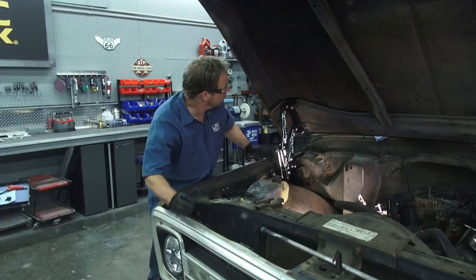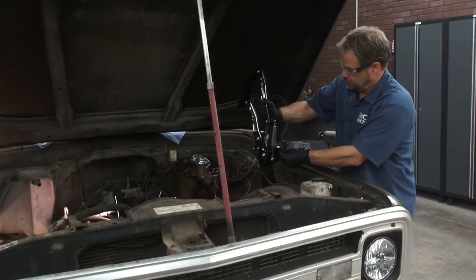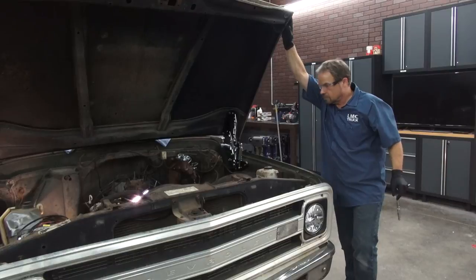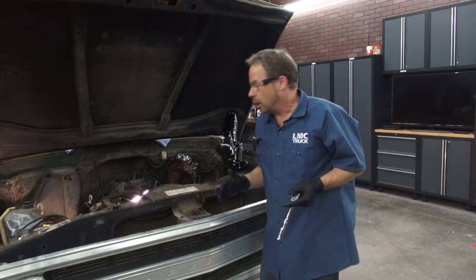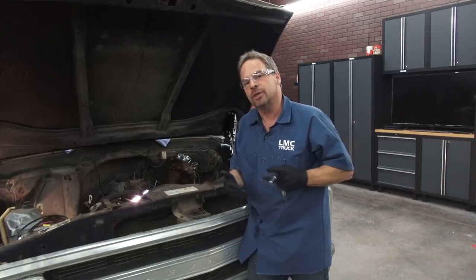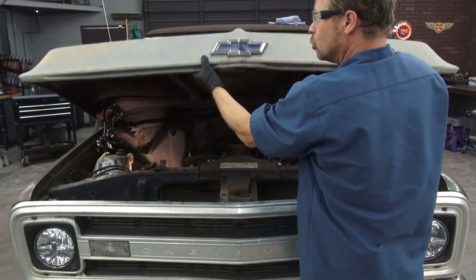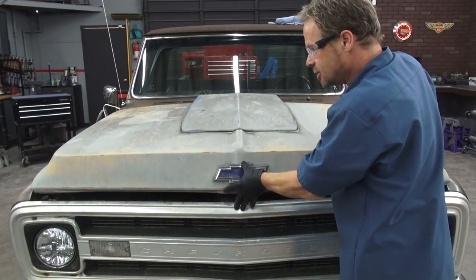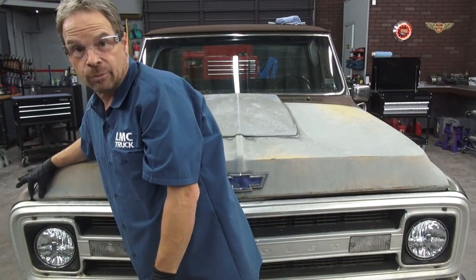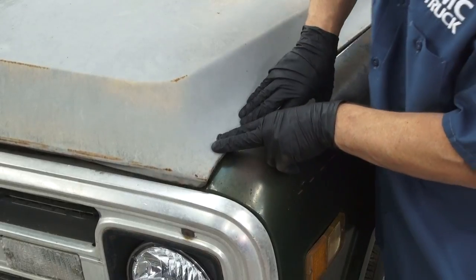Now we've got all the fasteners in, so we can start to fine-tune around our existing marks. Put the other side on and see where we're at. With the hood snugged up on the first hinge, the second is pretty much exactly the same procedure. There's a very good reason why I didn't want to have the striker or the latch in place when I'm bringing the hood down — I don't want it to pull it out of alignment and possibly jam the hood into my fenders. If yours has shiny paint, you'll thank me for that. Ease it down really slowly. Now taking a look — I'm seeing a giant gap right there, but over here it's overlapping and touching. That's why I didn't want that latch in place; it would have bruised my paint.